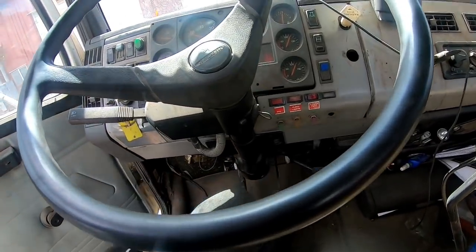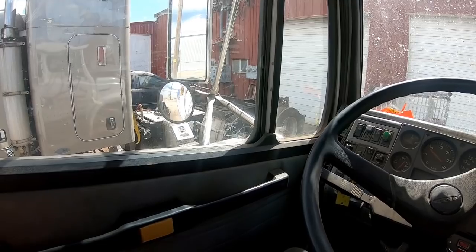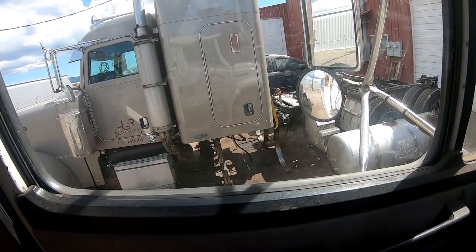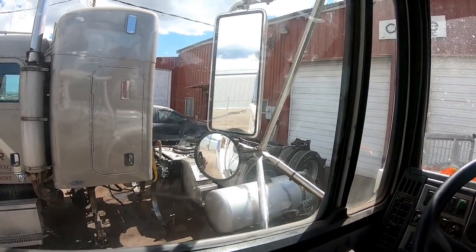Look out, bud. You gotta get in up where I can get in here. And started looking at the wire because, you know, why'd the fuse blow? And found a bare spot on the wire where it was rubbing on the frame and fixed the wire and said, there you go. Took me about 5 minutes.